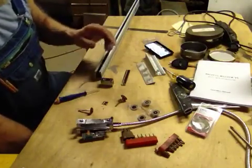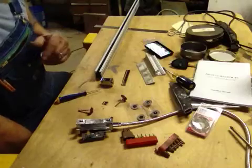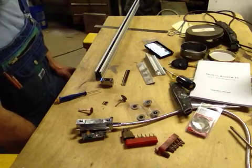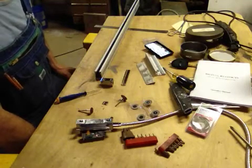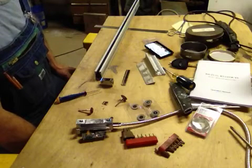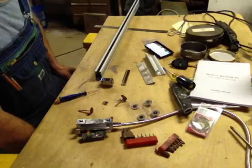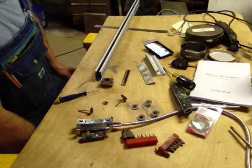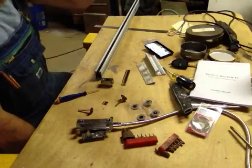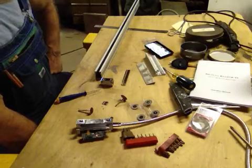I'll probably shoot another short video of assembling this thing. I very carefully took the reader section and slid it out. After I finished cutting everything, I flushed it out with water and let it dry overnight — I didn't want any heavy metal chips inside the slide. The next video you're going to see is the slides back together and mounted. What I'm finding is that it's taken between two and four hours per slide to mount, because even though they give you brackets, it's not enough — you need other brackets. By the time you finish fabricating and drilling and tapping into the Bridgeport, the fastest was two hours and the longest was about three and a half hours to mount the slides.